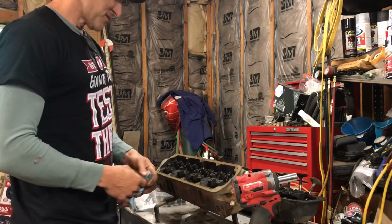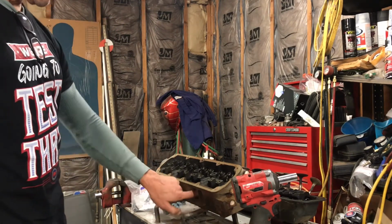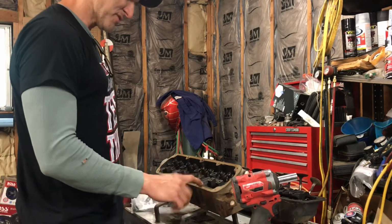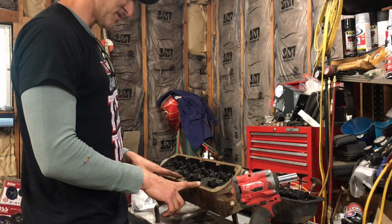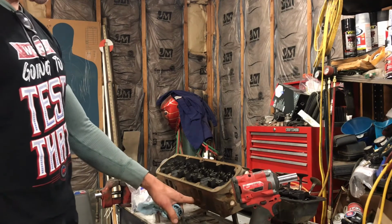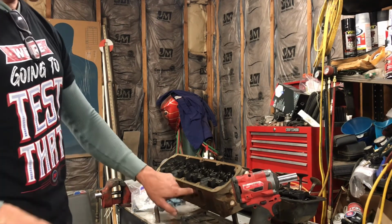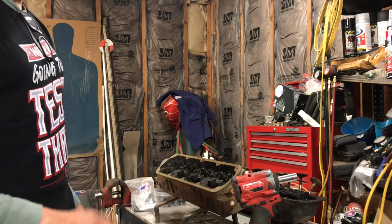Okay, we're going to do some bowl work, a little bit of cleanup. I know the pushrod pinch on these heads is extremely tight, so I'll blend the bowls, one side of the valve guide, cut it back, then open up the pushrod pinch, and that's all I'm doing.